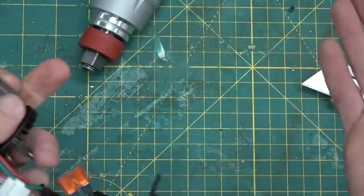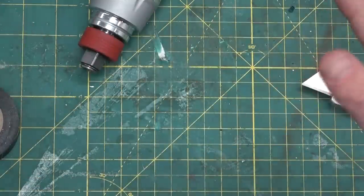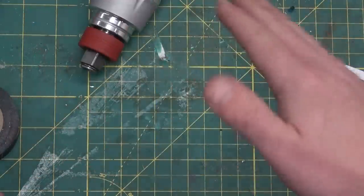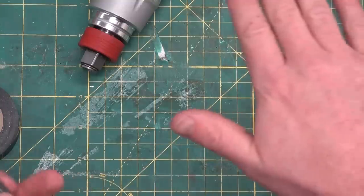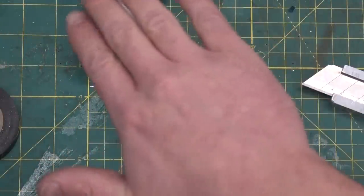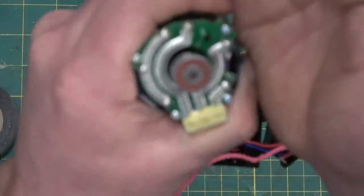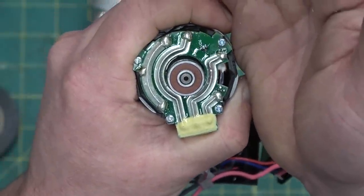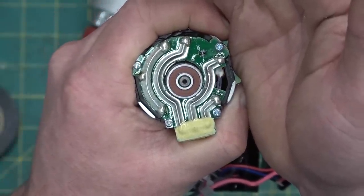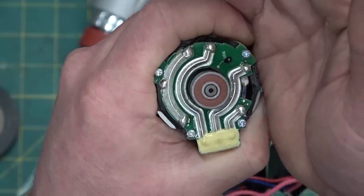Essentially you have a vat of liquid solder and then you pump it along so it goes over a trough, and as your board comes along it gets wet by that wave of solder, hence the name wave soldering. And sometimes in small components it doesn't work very well because there is a shadow effect, and you get tombstoning of the components and so forth.